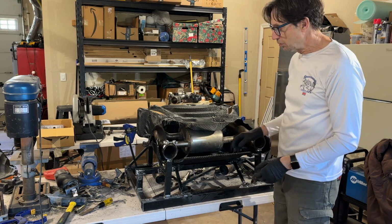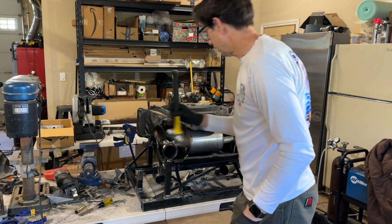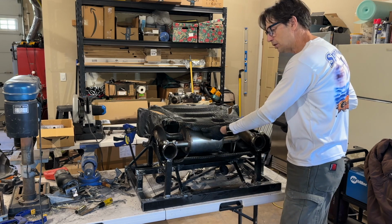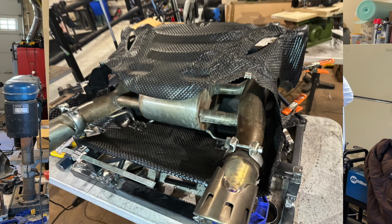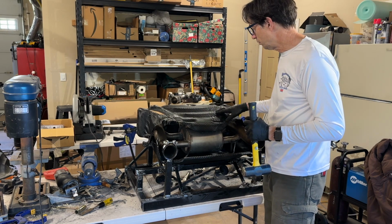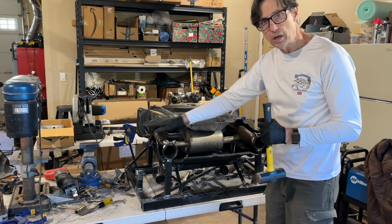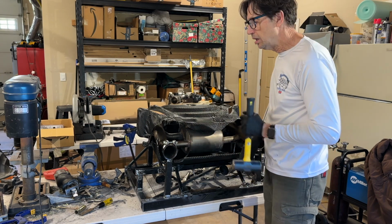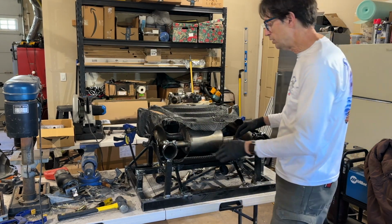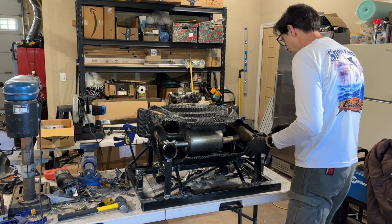I happen to know from looking through the back of my McLaren that I could literally just stick a tube straight across here from here to here and it would be fine. But as you can see, my exhaust is telling me another story, saying, hey dude, there's no shielding here. So you would probably need to get another junkyard piece of exhaust shielding like this, and mount it onto that piece so it doesn't melt the plastic tray that goes underneath the wing, okay? But you could do it. You could put exhaust back here if for whatever reason you needed to. You could almost double up the height of the exhaust tubes on these two sides if you needed to.